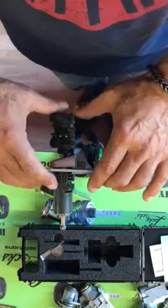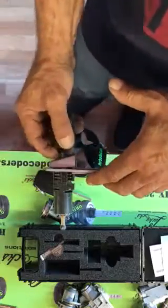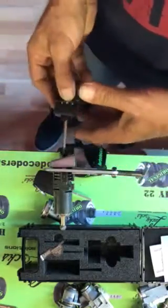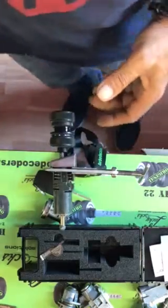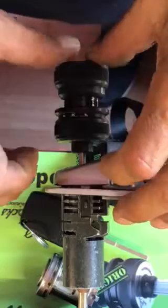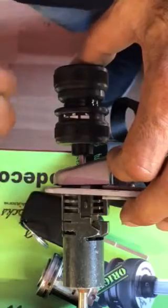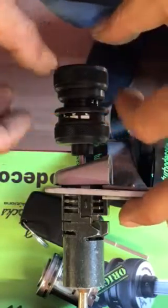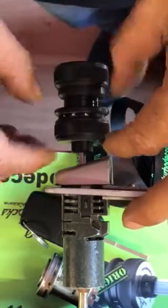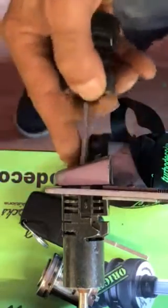When we touch the bottom of the lock, from here push forward. If nothing happens, we can try this: extract, reverse the tool, insert again and check from here. If we see this movement, it means that our tool is not correctly inserted, and it also means that we have an 8 disc lock, because there is a 7 disc lock with a missing first pin, and we will never see that movement no matter how we insert the tool. If we see this, we just click like this, extract, reverse and start the procedure.